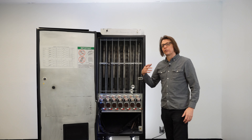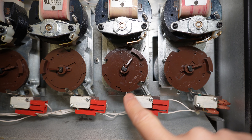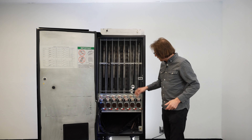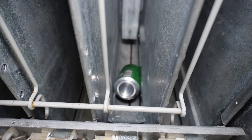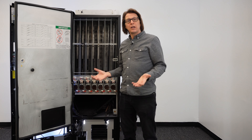So that's one of the reasons we have the homing process — to get the motor back. When we have a jam where it says 'try another selection' or 'sold out' on one particular section, you can take the cover off and take a look. If you've got something like this, you know you've got something stuck. As I was removing the cans from column number two, I saw where the issue was. There was one can that was wedged up against the cradle — as the can was trying to drop into the cradle, it didn't fall in completely and the cradle pinched the can.